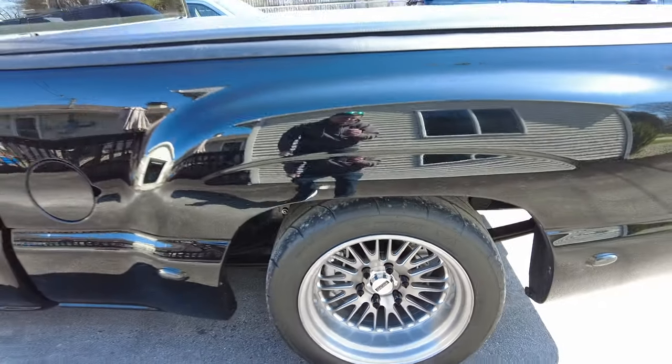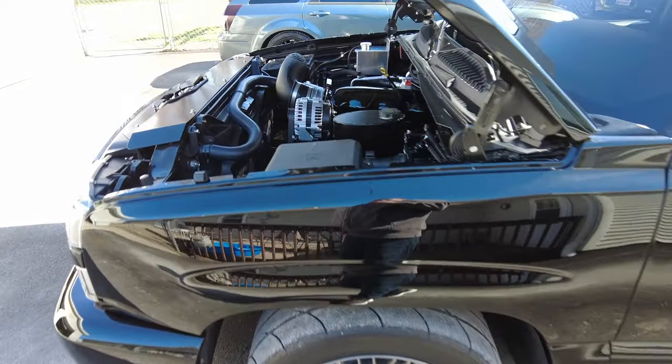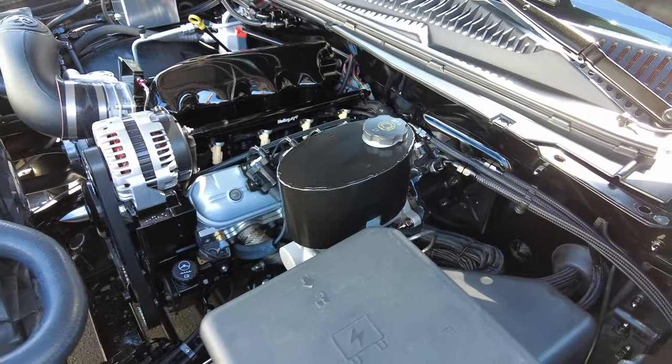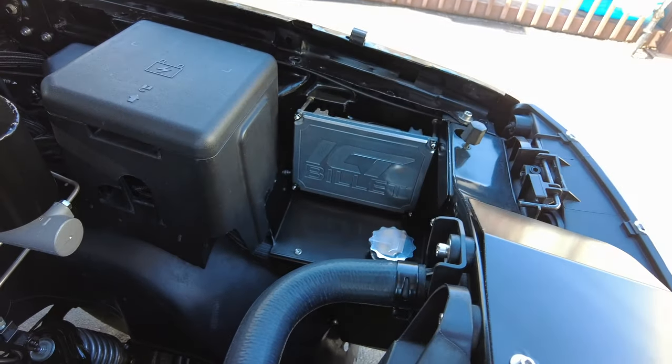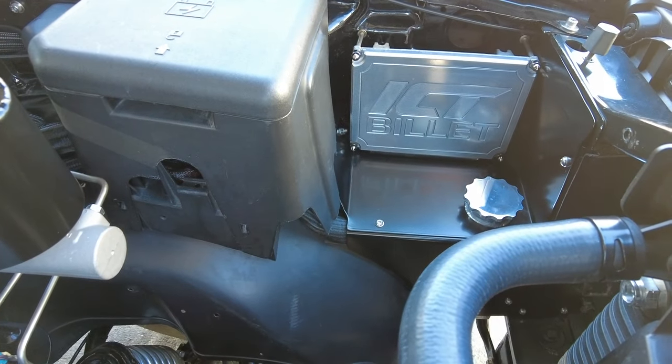We had those powder coated. So six pistons in total, and it stopped extremely slow. So we swapped to HydroBoost, and now this thing will lock the brakes up. It'll stop on a dime. We even went as far as powder coating all of our hose clamps, so everything looked nice and neat.